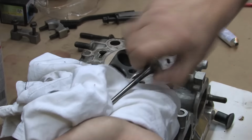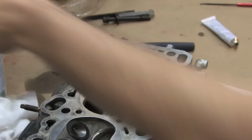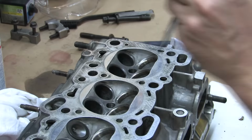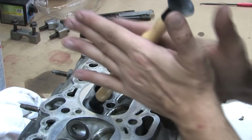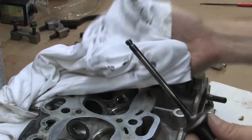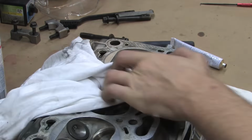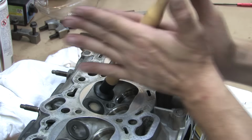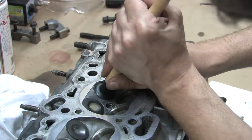There are other methods people use to do a valve job, but it's easy to botch the job if you haven't successfully learned this method first. There are also people who swear by using a power drill on the valve stem seal side. I have many problems with that method. It's too easy to put lateral forces on the valve stem and damage guides. It's too easy to pull the valve out of the chuck and scratch the valve stem. There's also a slight amount of play in the stems that can allow you to apply greater force on one side of the valve's face.